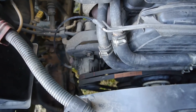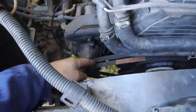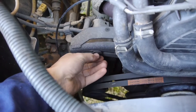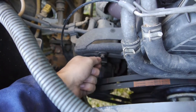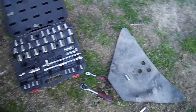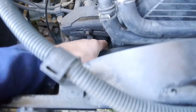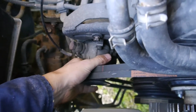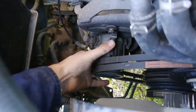That's the alternator there. Now to get these belts off, you need to undo this locking bolt here — that sets your tension. Then if you get underneath and remove that skid pan, there's another bolt underneath here where it pivots on. You'll see it, it's like a 14mm. Now I've already done that, so you can see that it moves around.